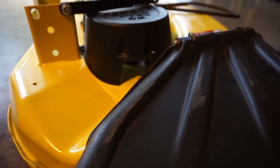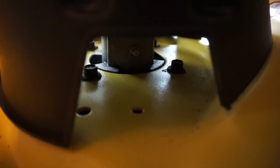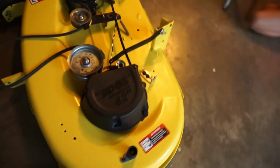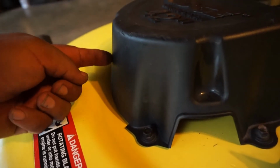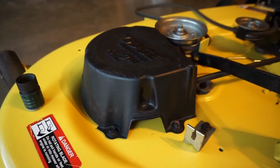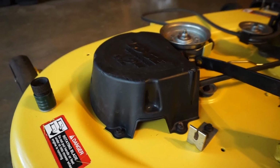Alright, one thing to keep in mind, and I didn't realize this when I was talking about it, but these bars actually have a cutout here to let you access the grease port for easy greasing. And the way I set this one up on this side, I pointed it the wrong way because the opening is right there and my greaser is pointing here. So I'm gonna fix that off camera, of course, and I'm just letting y'all know though, in case y'all do the same error I did.